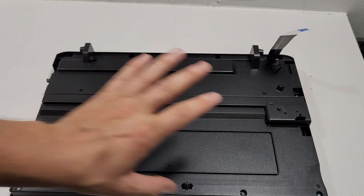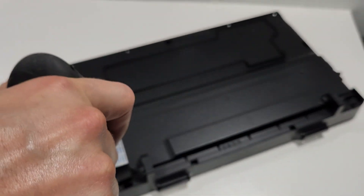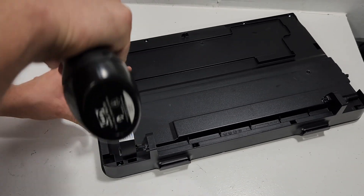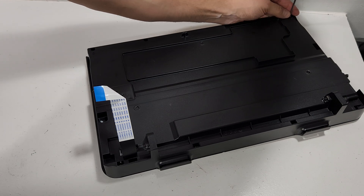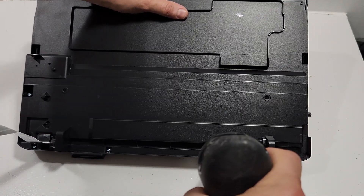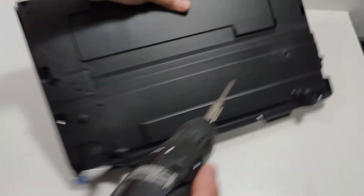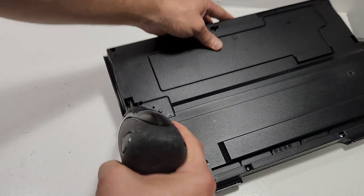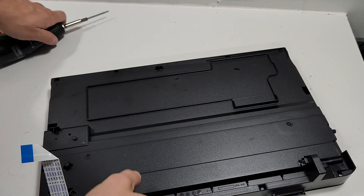That's pretty much what you get. It's amazing how a small device like this can do so much work. To get to the scanner, I'll show you the scanner unit — the contact image sensor. We need to remove screws: one, two, three, four, five, six, seven — actually nine screws total. Then on each side there's a clip, right here and another right here, so we just need to push it back with a screwdriver.